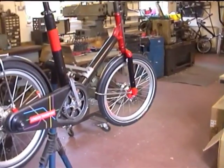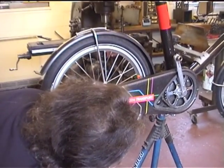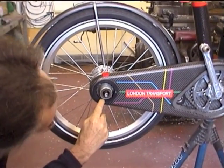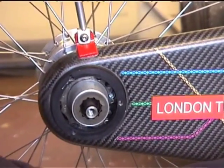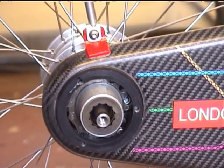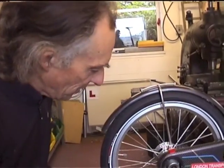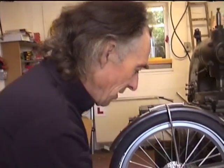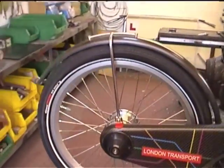This is basically the sort of job done by a bike shop normally. You've got a spacer, that's your outer bearing, that goes there. That is your Shimano cassette body with a single 13-tooth Brompton 3/32 sprocket sitting on it. With this removed, the chain is slack enough to gradually work the chain off the sprocket and pull that out, because behind that is the brake arm. So if you need to adjust the cable in the brake arm, it's behind all this. With the inline adjuster you shouldn't have to do this very often — like once every two or three years depending on how much use it gets. The brake arm has to be inside there — that's where the sprocket is. I'll put a drop of Loctite on these screws and seal it back up.